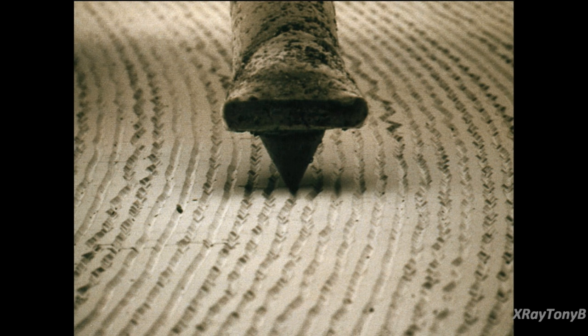Going back to our close-up image of the stylus in the groove, you can see how important it would be for that stylus to be totally perpendicular to the groove. If it's tilted to one side or the other, it would not track properly within those grooves. On one side of the groove is your left channel information and on the other side is your right channel. Depending on which direction the cantilever moves, it's going to affect your stereo separation and the output of the signal. That's why in this alignment we're trying to get that stylus as straight in the groove as we can.